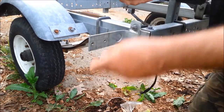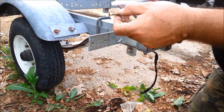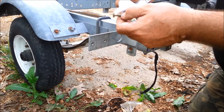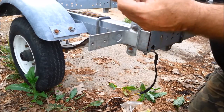Before we install fasteners, we want to put some caulking on them. This is a sealed air vessel — kind of like an inverted cup in the water. It's open on the bottom but not on the top. So if no air can get out the top, no water can come up through the bottom. That's how submersible lights work.